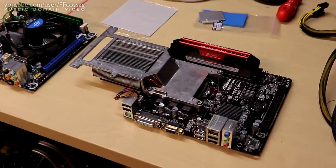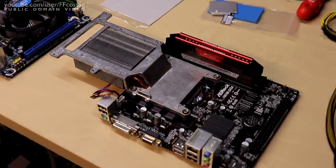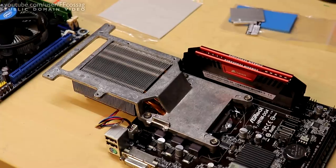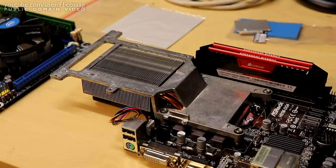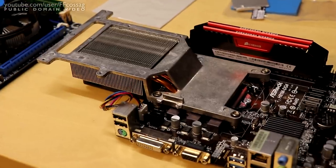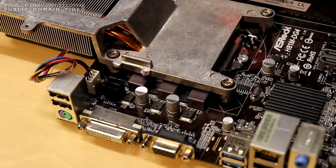We're obviously going to be installing this into the case; however, that does bring a few challenges. The thing that sticks out the most about this board is, of course, the fact that it's got a rather unique cooling solution. This heatsink is reportedly from a Dell small form-factor PC and does not provide any airflow across the motherboard at all, making the VRM on this low-end ASRock motherboard feel a bit harassed.